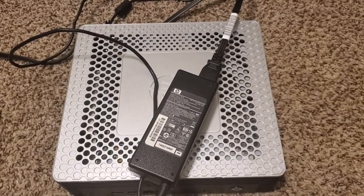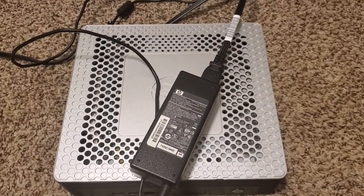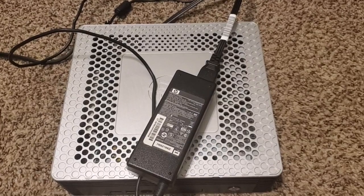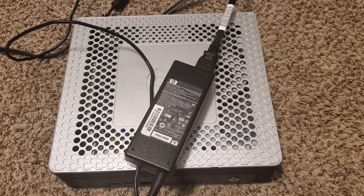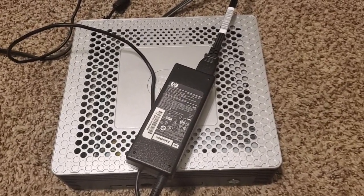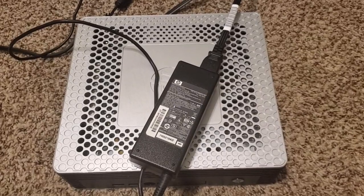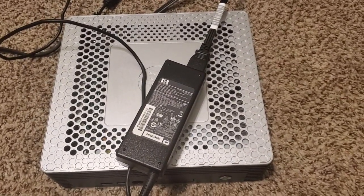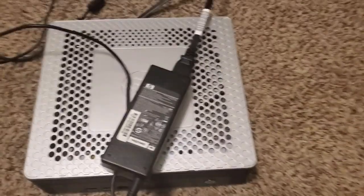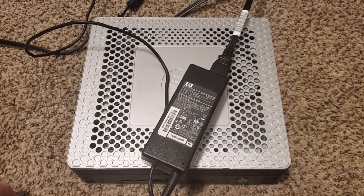Also, the only reason this box works directly with Cincinnati Bell Fioptics and not anything else is because, as you saw at the start of the video, where it connects into the WAN, that's an Ethernet jack directly into the wall. What I'm guessing is happening is that at the service block outside, the junction blocks outside the house, all the fiber and Ethernet and internet signals are converting, merging, etc. That's why you can get away with the Ethernet adapter in the house. And as you can see, it was clearly working.